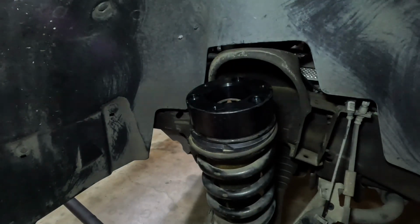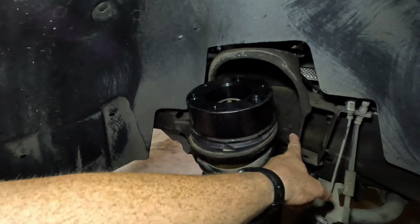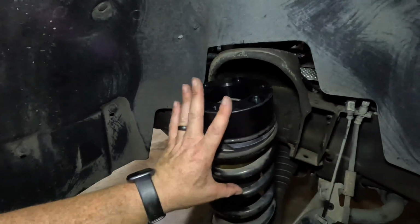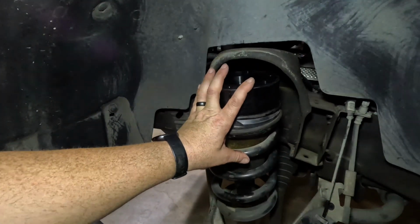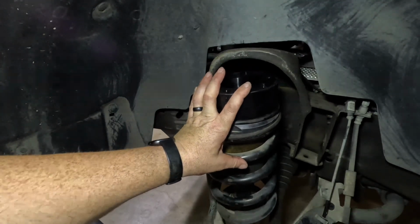So now I'm going to get these 3 nuts tightened down, and then I'm going to get my new upper control arm slid in and get the bolts pushed in while I have good room to get my hands back here and get that started. Then I'll push this up and in and get those upper bolts in, and this side will be getting close to done.